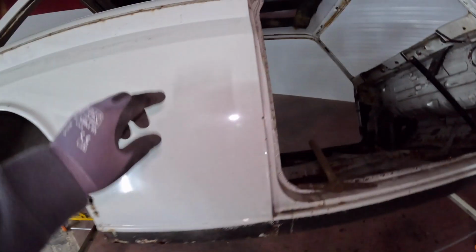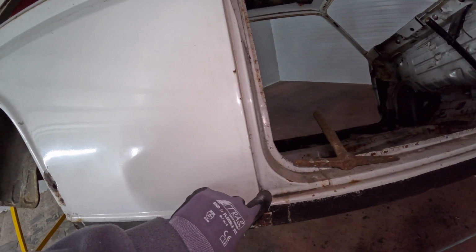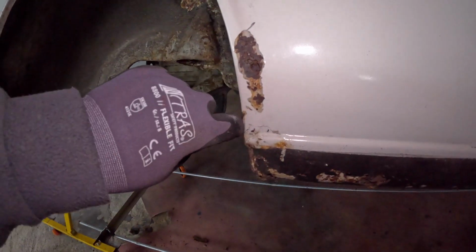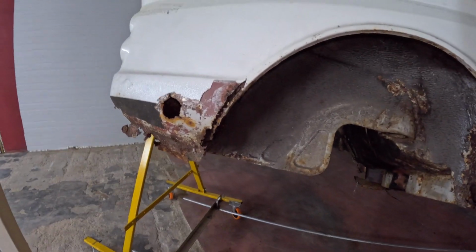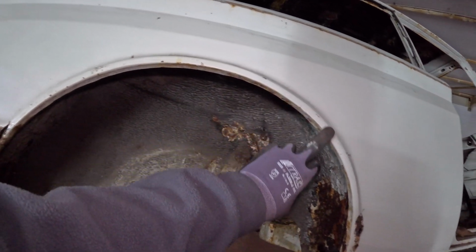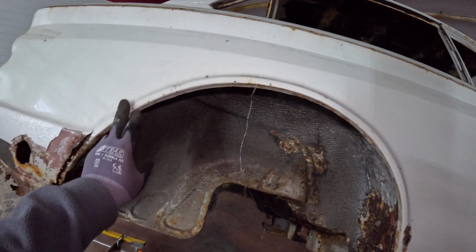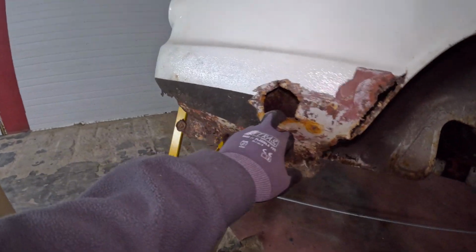Quite a bit of plugging from where they come from. So to remove this panel, spot welds here. This is only seam sealed. Floor, arch, and as I had mentioned, my favourite method of removal for these, which you will see later when it comes off, is I will actually take this lip at the very corner and I'll take a flap disc to it. The flap disc shears through the edge very, very easily. Yeah, enough said now, I'm going to take that one off.